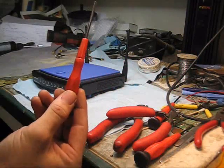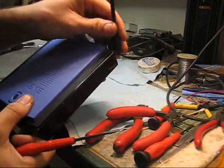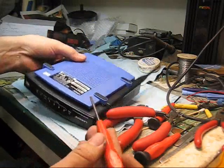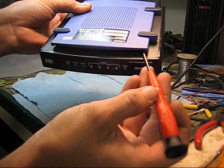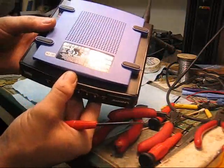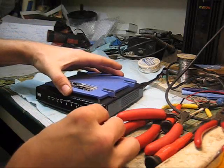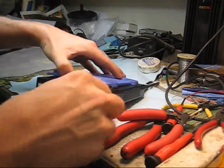Alright, the first thing you want to do is start out with a pretty good small-size standard screwdriver. Flip the unit over to the back — you're going to take this panel off right here. Insert the screwdriver and try to wedge it in right here; there are two little clips right here that you're going to be pushing on. You can work at either angle. I've already had this unit apart, so I just have it sitting together to show you guys quicker. Basically, you're going to push in and pry up, and you're going to hear kind of a pop noise so you'll know that you have that clip released.